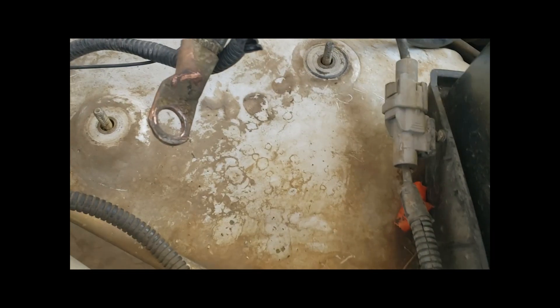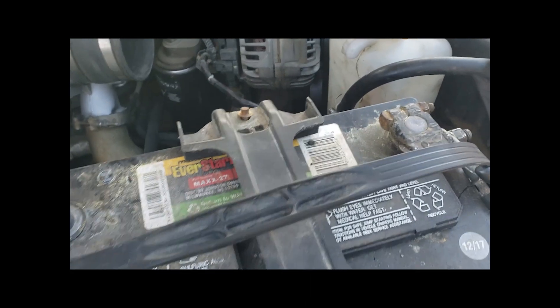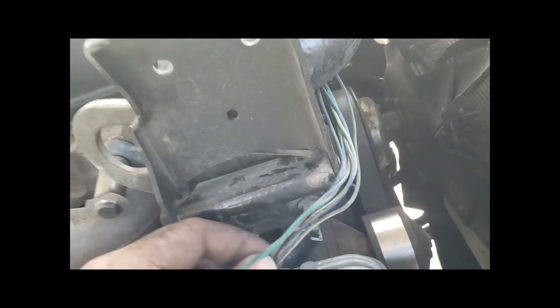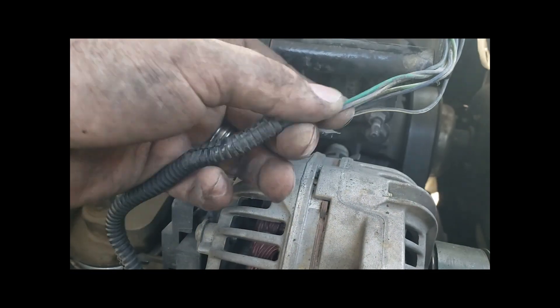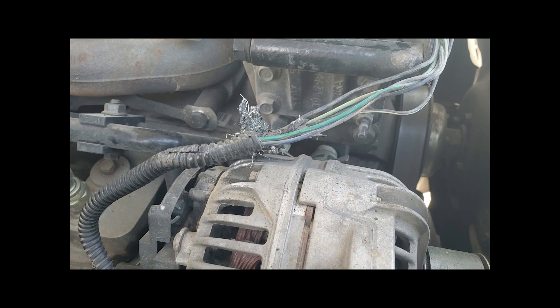So I'm going to stop right now because I've got to get some parts and wait for the PCM to get fixed by a computer company. I'm going to replace the battery terminals on the side also because that one is ugly. Basically, what I'm going to do when I come back is just unwire this and hard connect it and solder it, as well as put in an inline protection fuse for — I think it's this blue wire on the alternator. Whatever one goes to the PCM — I think it's this blue one right here. I've got a 7.5 amp inline fuse for that.